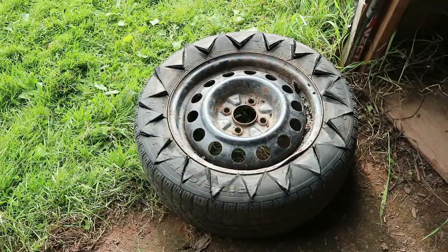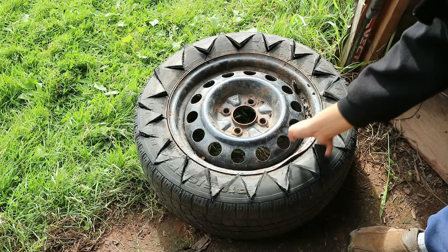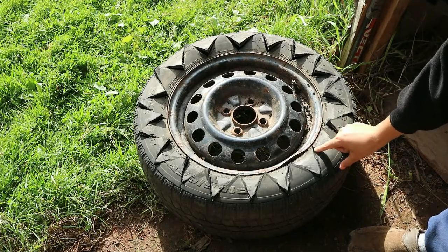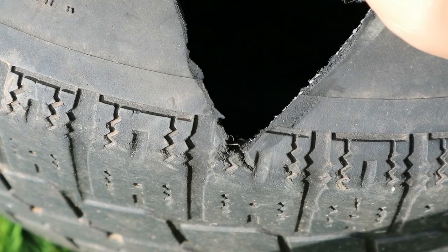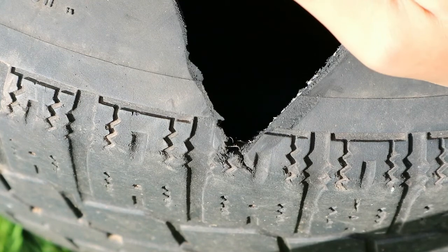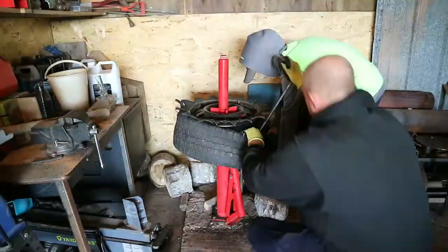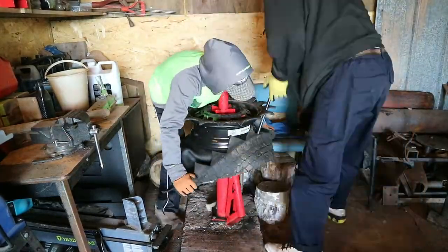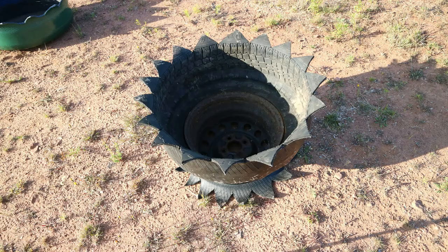At this point, if you're using a tire without a rim, the inner part of the spikes will just fall to the floor. Once that happens, you have to flip the tire inside out — I'll show you that in a moment. One thing to watch out for: if you go too deep into the side of the tire, you'll hit metal wires that hold the tire together. They are extremely sharp, so if you're going to be selling them, just cover those up with tape or something. We finally managed to flip our tire inside out using a tire changer, and it is well worth it.